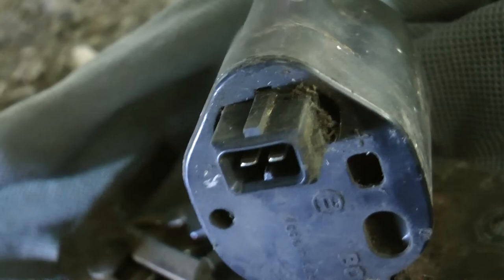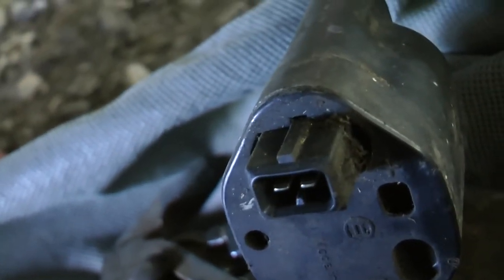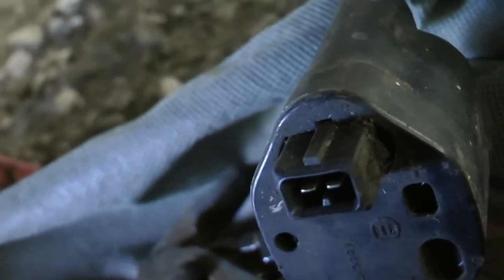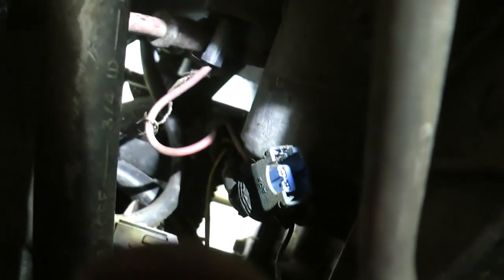So you don't have to wonder how the hell do I get this off. The coil is off now. I'm going to go and test it and see if it's good. If it is good, then we've got to go further back in the electrics - I'll put a test light on those pins in there to make sure the power's getting to there. It could be the wiring form itself yet, so we'll cross that path when we get to it. Thanks for watching.